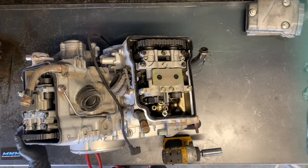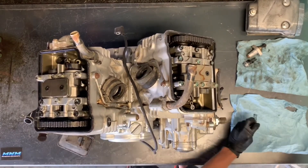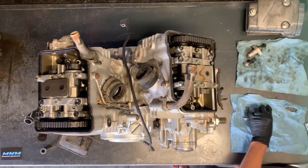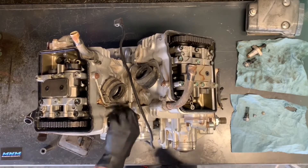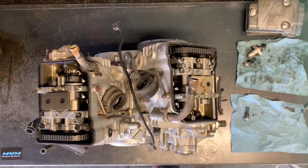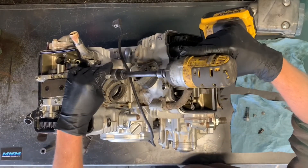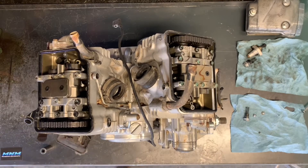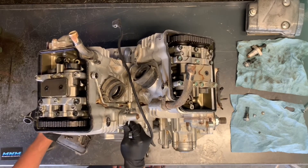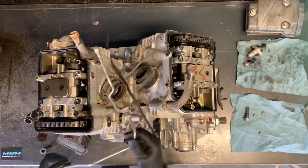Because of where it's at, we're going to have to get a wrench in there. This is a 17-millimeter cap on the top one, to the front of the motorcycle. I'm going to remove that and pull this tensioner here. Now we've got this front tensioner ready to come off — take and tap on that to break the seal free. We've got a hose and oil line here that is kind of holding this up, so we're going to remove this oil line. We've got those two 8-millimeter bolts off, a 10-millimeter up top, and another 10-millimeter lubricating the front cylinder head. There's an oil line clear down here — it takes an 18-millimeter and has an oil sensor on this plug. Oil line's free.